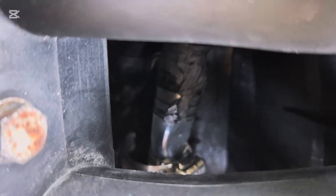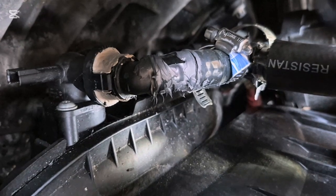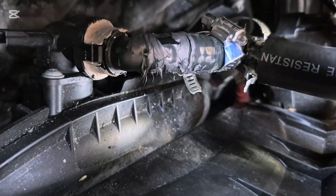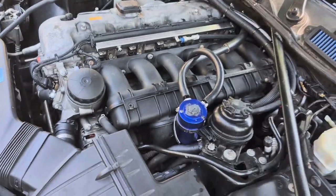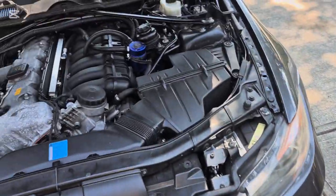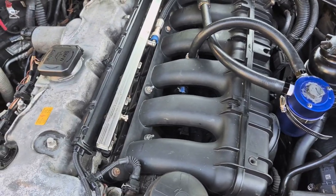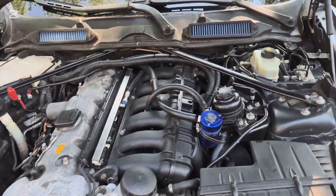Where I cut it, I simply just cut it and added some tube there, hose clamped it to the T. You can see way better in there now — it doesn't look pretty but it seals very good. This is one spot I never had a vacuum leak from. Too tight is way better than too loose, so keep that in mind. Once you've got everything plumbed up, make sure all your sensors are plugged in if you had the manifold off. I did have the manifold off to do the T thing down there. Some people have said they did this without taking the manifold off — I have no idea how, but if you can, all the power to you.